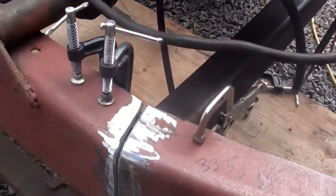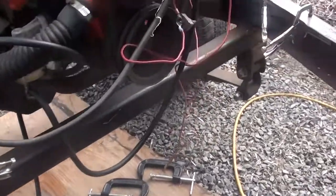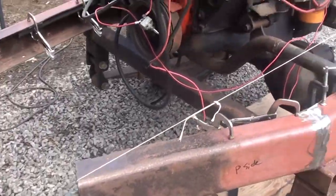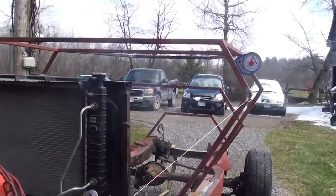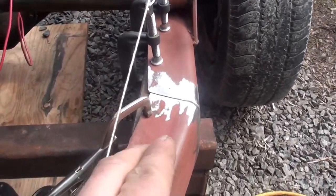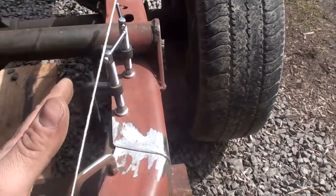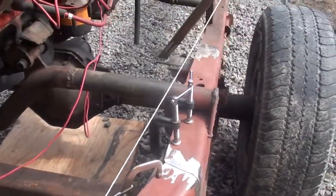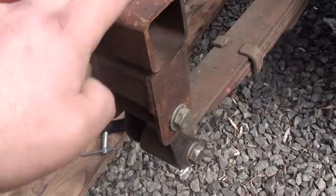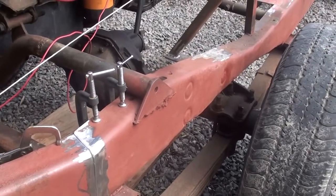We've just cut the frame at the back right here and we've got it on an angle now so it sweeps back. The idea is that the frame more closely matches the angle of the side plate - you can see the string there goes up to the corner and comes down. Unfortunately there's just a tad bit of this frame that's going to jut out just a little bit past our line as the line swoops down. There's not much we can do about that because the shackles for the rear suspension are mounted here - we can't adjust that line in any further without major rebuilding.